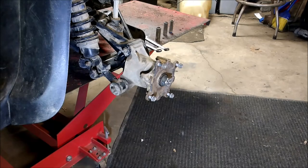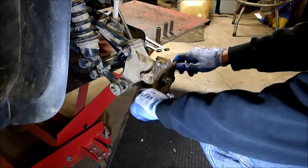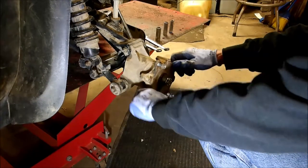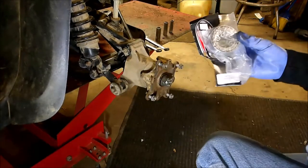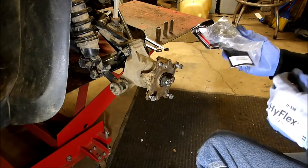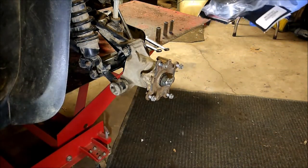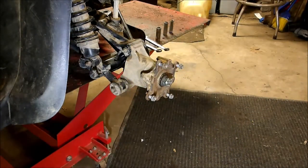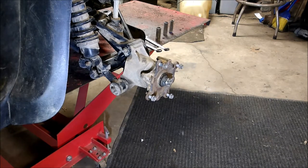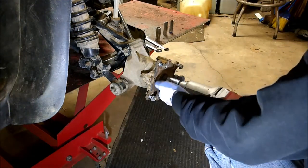I've got a bad bearing in my rear wheel so I thought I'd shoot a video and show you guys how to replace it if you got the same issue. If your tire is wiggly — see how that hub wiggles really bad — there's a bearing inside of here, it's about $33. I gotta pull this all apart, take this out, and press the hub back in. I'm just gonna go ahead and go nuts and let you know what I'm doing.